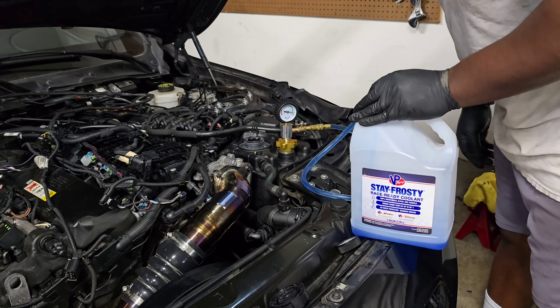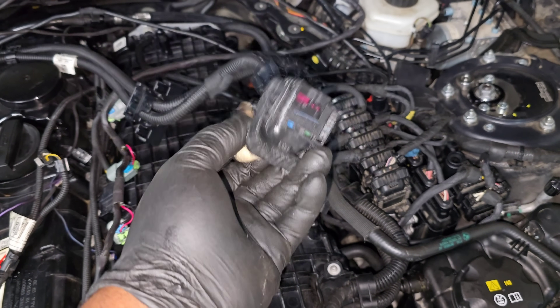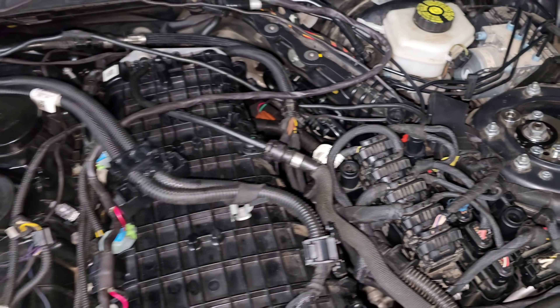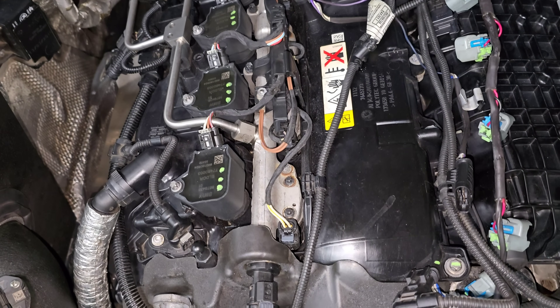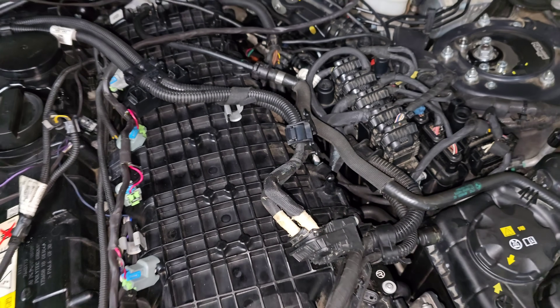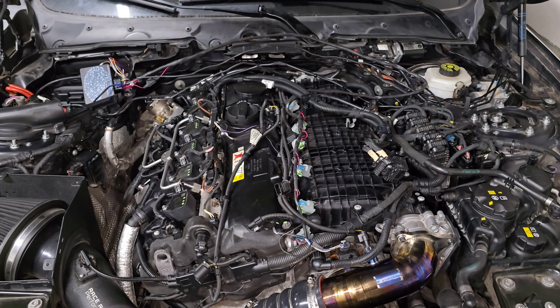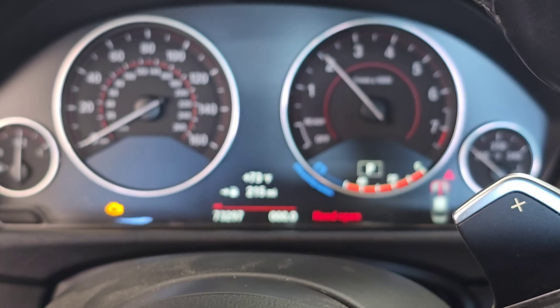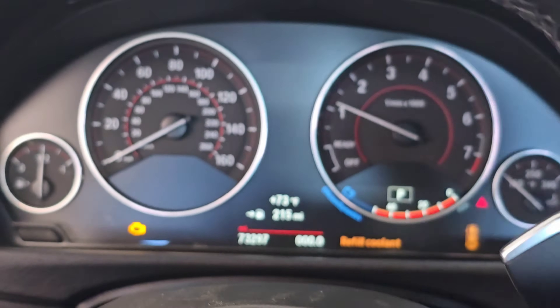Lastly, we need to prime the engine, and this is done the same way you prime the turbo. Try to start the engine with the number six DME connector unplugged, or at a minimum unplug all six injectors — this will keep them closed so no fuel will spray into the engine. If you only unplug the coil packs or the high pressure fuel pump, some fuel will still spray into the engine, and even if it doesn't start because the spark plugs aren't firing, you're still dumping fuel in there without it burning. So no fuel is the preferred method. While the engine is cranking, you will get the oil pump turning and that will increase your oil pressure and push oil throughout the engine.